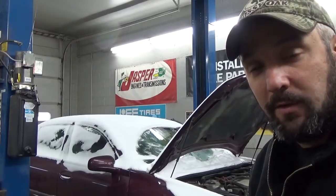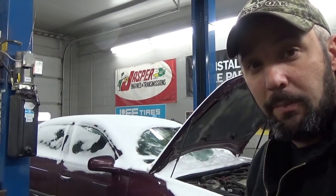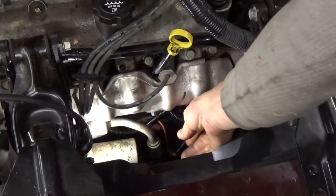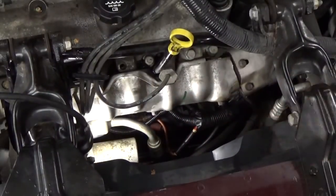I've got one on its way. I'm going to get a little bit of video to show you where it's leaking from, in case you have the same problem with yours so you can identify it. Then I'm going to show you how to replace your oil pressure switch. It's located right up under this manifold — pretty difficult to see. You can see that orange wire there; follow that straight in above the starter and you'll see the oil pressure switch.